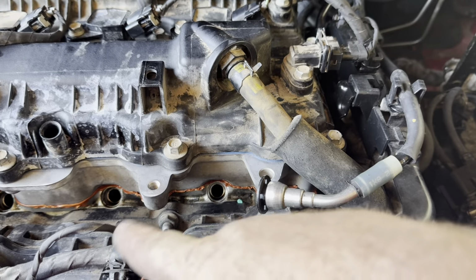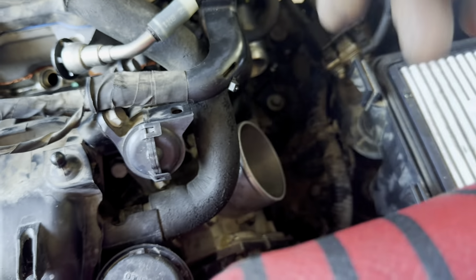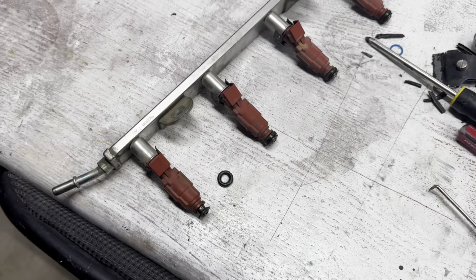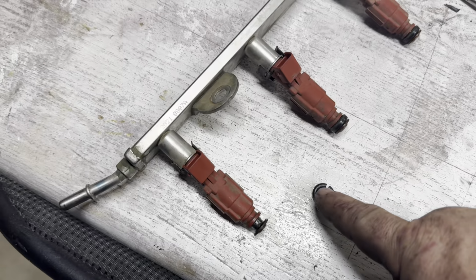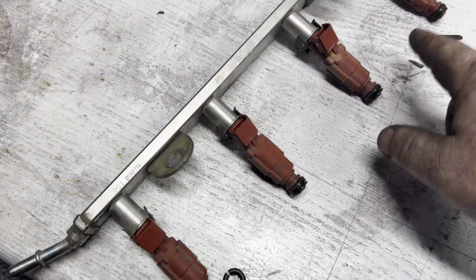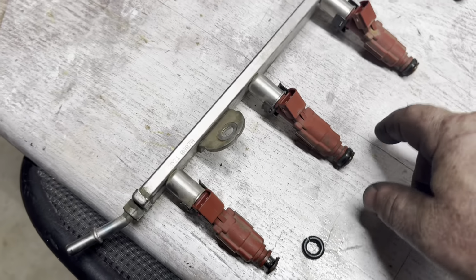I'll go get the fuel injectors, put those on, put this hose from here, or from that, up here to this, crawl underneath, put the pan on, and all that. Those injectors. Ah, damn it. Well, the head gasket kit don't come with new injector rings, but I took them off because they looked really smashed and flat, and that one broke. So now I guess I'm going to have to find somebody to bring me some injector rings.